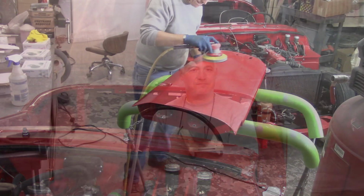Alright, welcome back everybody. Discretion is the better part of valor. I've decided to cut the doors back down with 600 and build them back up through a couple coats of base and clear. I also think I'll get that top of the boot lid done, so we'll see how this goes. Thanks for watching.